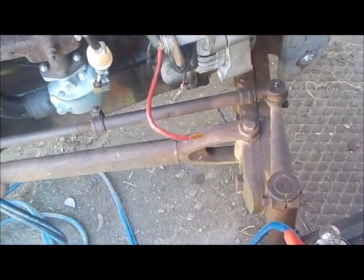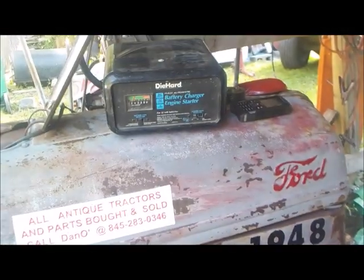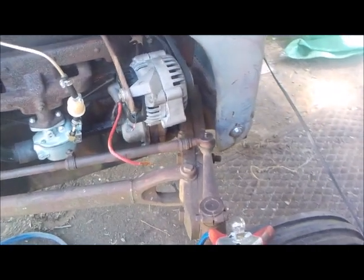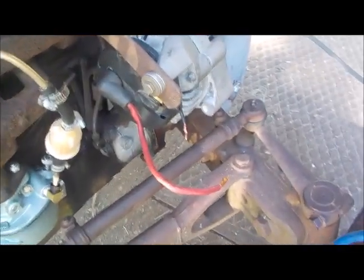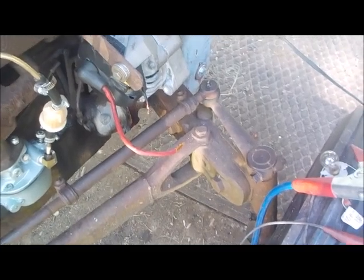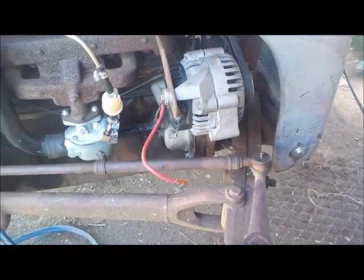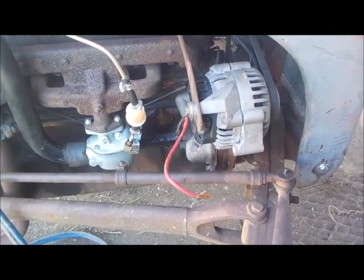The last thing I want to do is start her up and see smoke pouring out of that alternator. Now I feel safer hooking it up. I'm going to run the wire to the dashboard, get things hooked up, and get the battery charged — got the old Sears Die Hard here, must have had that battery charged over 20 years and it still works perfect. I take my sweet time with electrical work — I don't care if it's boring. Hopefully this thing is going to fire and I'll be able to show a charge on the meter.